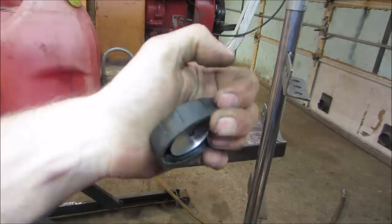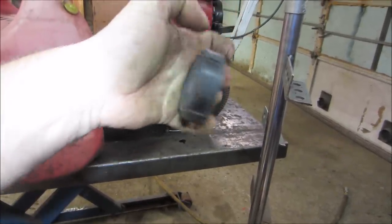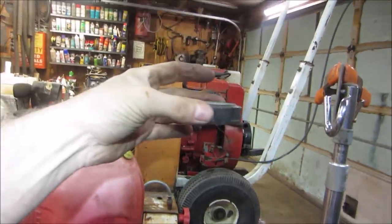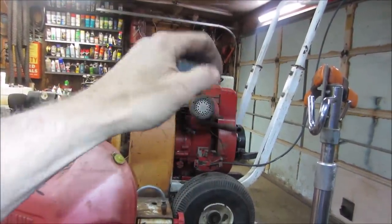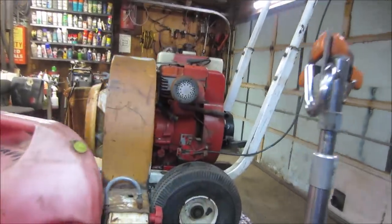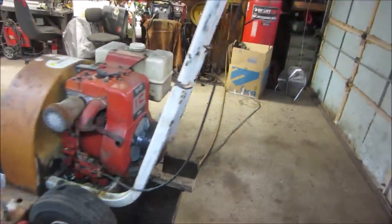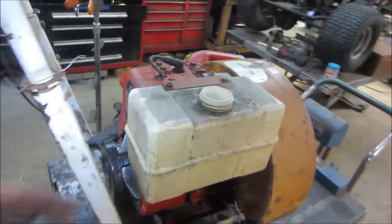It has to be because, you know, if you put your finger over the top of a straw, the fluid can't come out of it. So if you put a cap on top of the fuel tank and you're trying to draw fuel to the carburetor, at some point it won't be able to flow until air can come back in behind it. So by nature, these are open to the atmosphere. You know, your car, you crack the gas cap, it can maintain pressure. Well, these systems don't do that.